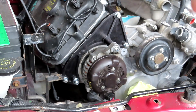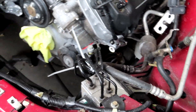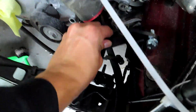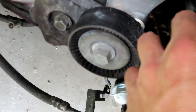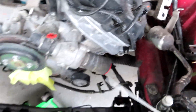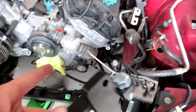So now that's everything done with the alternator. This other side right here will have the power steering, so let me get to that. This is what we'll call the power steering bracket. It's supposed to fit nicely like that, but I'm going to have to remove that tensioner to give me room. They also supplied another tensioner for the drive, so I'm going to go ahead and do that.